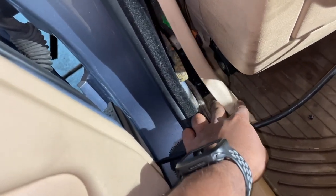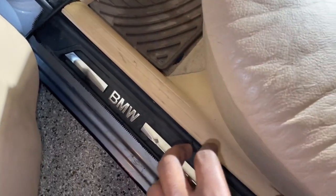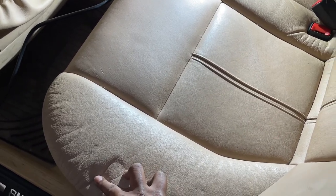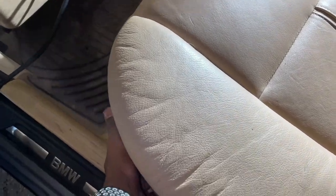Coming to the back of the car, you can see that exact same panel right over here, also popped out. Very similar panel to the front, except there's actually a bolt tying it in, which is below this seat. So regardless if you have the bench seat or the foldable seats, this bottom bench will need to pop out. You gotta grab it below like this, pull up, and it'll make a kind of violent popping sound. That means you've released the clip.